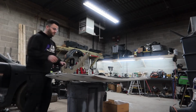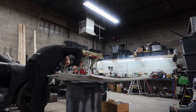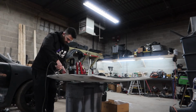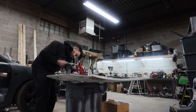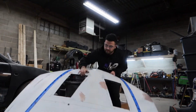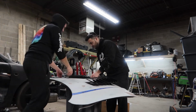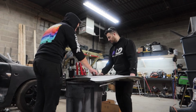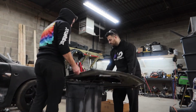I had to do some trimming on the underside of the hood and take off some of the hood bracing in order to create room for the vents on the underside of the hood and room for the hardware so I can access the bolts and the nuts. And then of course I have to test fit the vents when I'm done and make sure that they fit. Here they fit mostly, but I needed to sand the edges of the holes down to make sure they fit in smoothly, and also to not scratch my hands up as I work around in there.